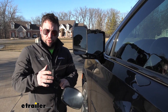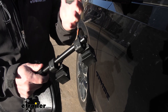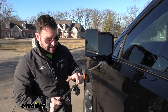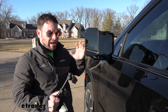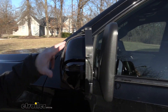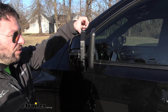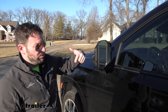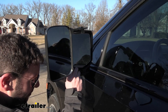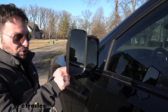This is going to be an example of some universal fit towing mirrors. This one clips in — you tighten these down and it goes around the mirror to hold on. On this vehicle, a Tahoe, it wasn't able to open up enough to get a good hold on the mirror. It stayed too far to the outside, so I didn't feel it was safe to put on and drive. The other one has the strap design — two rubber straps that run around the back. It has a decent hold, but you can see just doing this, that's what happens when you're going down the road — a little bit of shaking and moving. Not to mention I had issues reaching out through the driver's side window to adjust the mirror, and the whole thing moves back and forth. I can tighten the straps down, but it can only do so much going down the road.